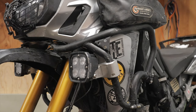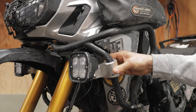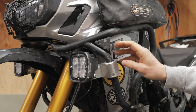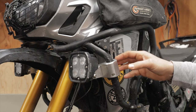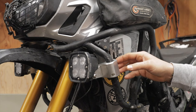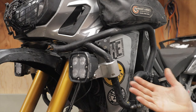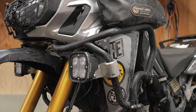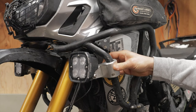They are very lightweight because they're aluminum, and they come with stainless steel hardware to clamp them to the bars. Make sure when you put these on that you use blue Loctite, because the bike vibrates and I can see how, without Loctite, these could possibly loosen up over time. I haven't had that happen because I use Loctite.